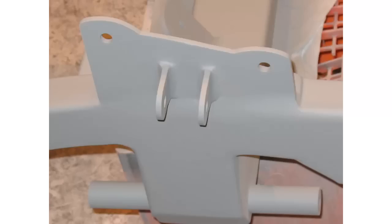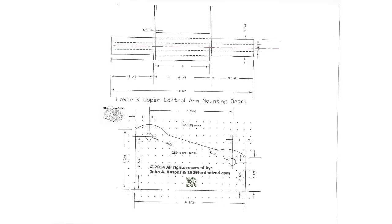I was hoping to have my coilover shocks mounted inboard behind the radiator, but due to the small size and the stock wheelbase of 103.5 inches, I had to leave my coilovers on the outside of the frame. The majority of the nuts and bolts used in the Corvette are all metric. For the lower control arms, I needed to drill out the metal insert inside the rubber bushing with a coated 1/2-inch drill bit.